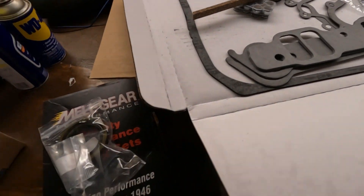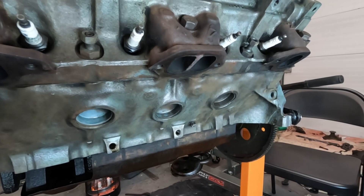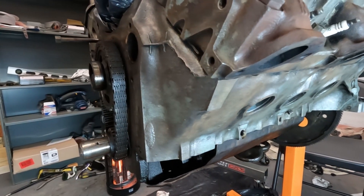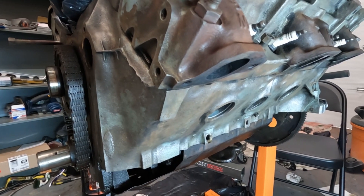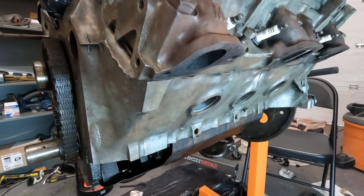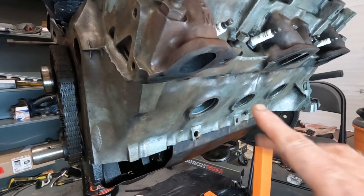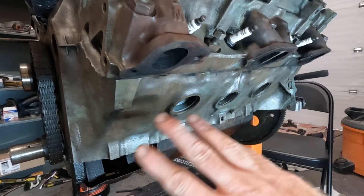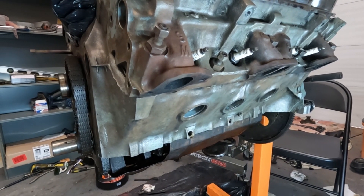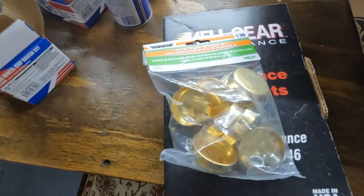Got some fun toys to put it all back together. I think I've got the block as clean as I can get it. I've used a heat gun to apply heat and dry off the engine as much as I possibly could. I know some people use torches to heat up the block, but I don't have one and I don't really trust myself putting flame to anything. I'm going to hope the heat gun got it nice and dry. The next step is going to be to apply an acetone rinse of the entire engine, and then we'll do the primer and the paint. I also got my freeze plugs so I can replace those once everything's painted up.